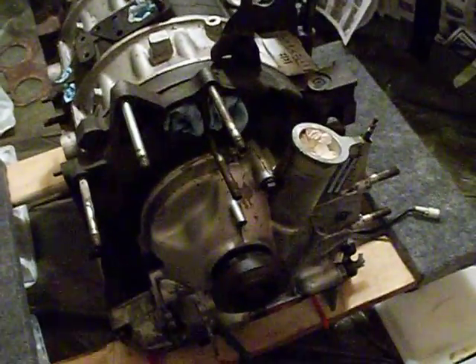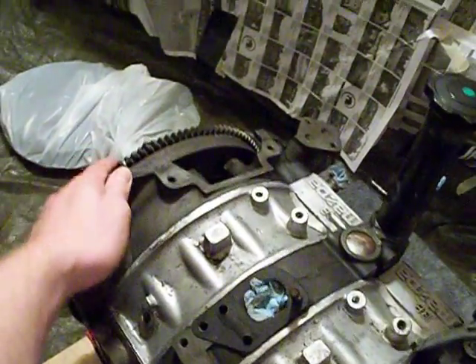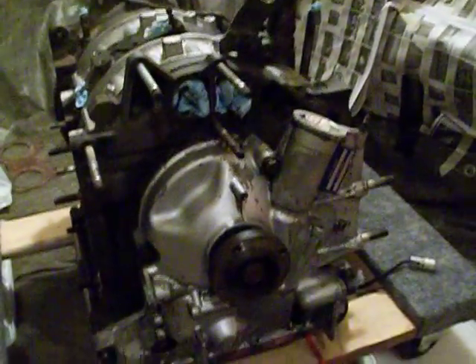And that, in a nutshell, is all the ports, openings, and passageways in the engine once everything has been removed. Another thing that could be removed is the flywheel back here. That takes a 38mm big wrench — I have to buy that actually, come take a look here. You can see there's quite a large nut to be removed, so you're going to need a special tool for that. Otherwise, everything's been stripped bare, the engine's been cleaned, and it's ready to be taken apart and rebuilt.